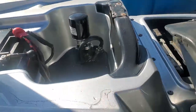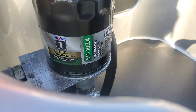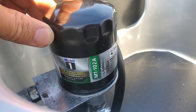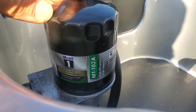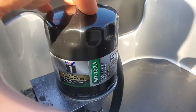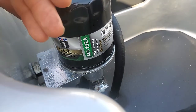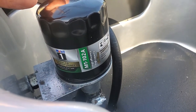For this we're going to use a different oil filter — don't use the BMW one. Go with the Mobil 1 M1-102A. This is a larger filter than the BMW one so it does a better job of filtering the oil, but more importantly it has a check valve in there that allows the oil to stay in the hoses so that when you turn it off the oil doesn't just go back into the sump and give you a dry start when you start it next time.